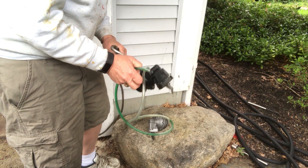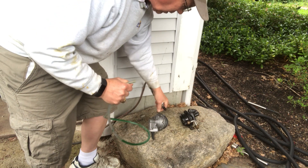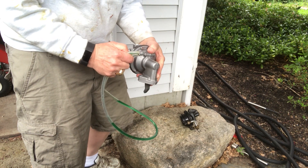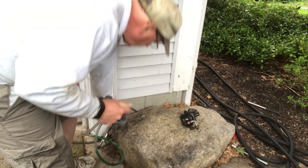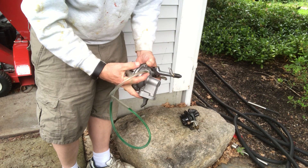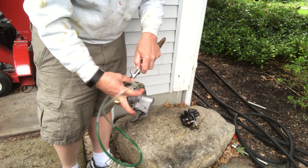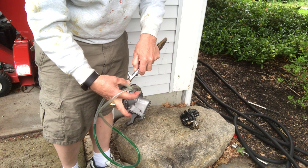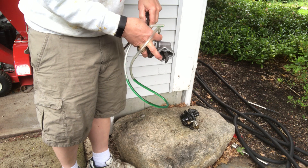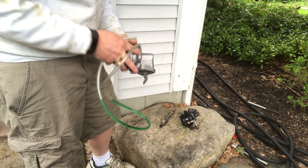As you can see, it shoots water out of the tube, which means the diaphragm is perforated. I have a new pump of the same type, and I just want to test that to make sure that it does in fact not push water out. And as you can see, in the tube the water does not move.